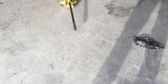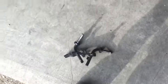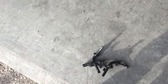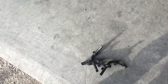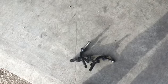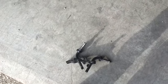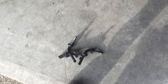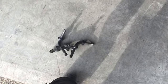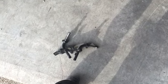It's just stupidity. Anyway, I'm not gonna buy new ones. I'm gonna build them up with weld and then take them down. I got a friend down the road that has a really good lathe, so we'll just chuck it up, build it up with weld, and then take it down to match the bushing that was in there. I'm gonna take the bushings back and save the guy a couple bucks. Well, 50 or 60 bucks to be exact, and I'll just build up the shaft to match the existing bushings.